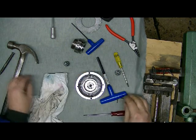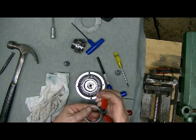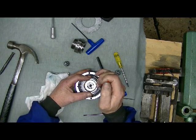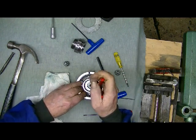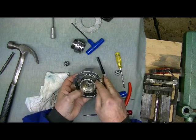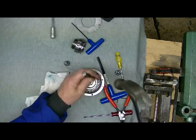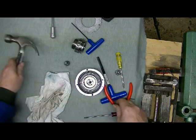Get the circlip pliers and your circlip. Now because you have to see what you're doing here, you can't put the cloth over it very easily. So just space your fingers at each side of the circlip, just in case the pliers slip — still got my safety glasses on — then slide it down over the boss. I always check by getting a hammer and a punch and just hitting the eyes of the circlip and the back of it to make sure that it's all in there properly.